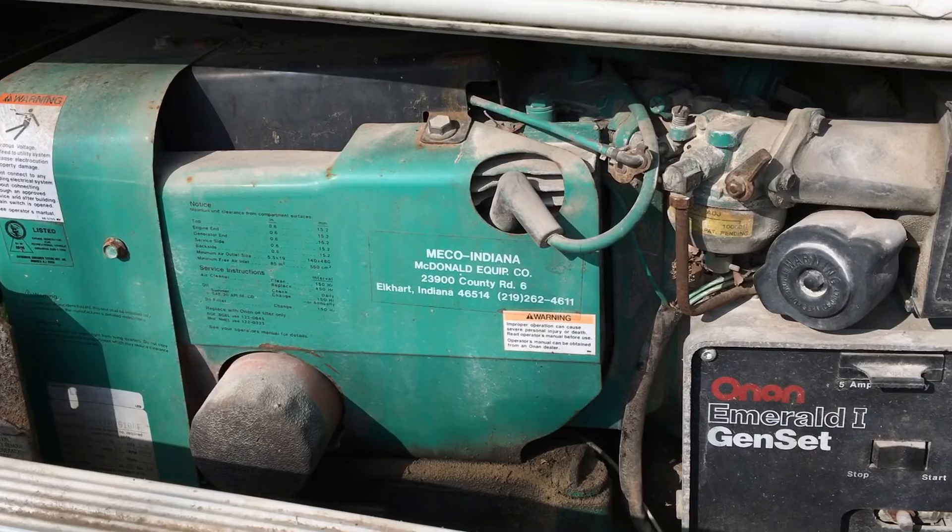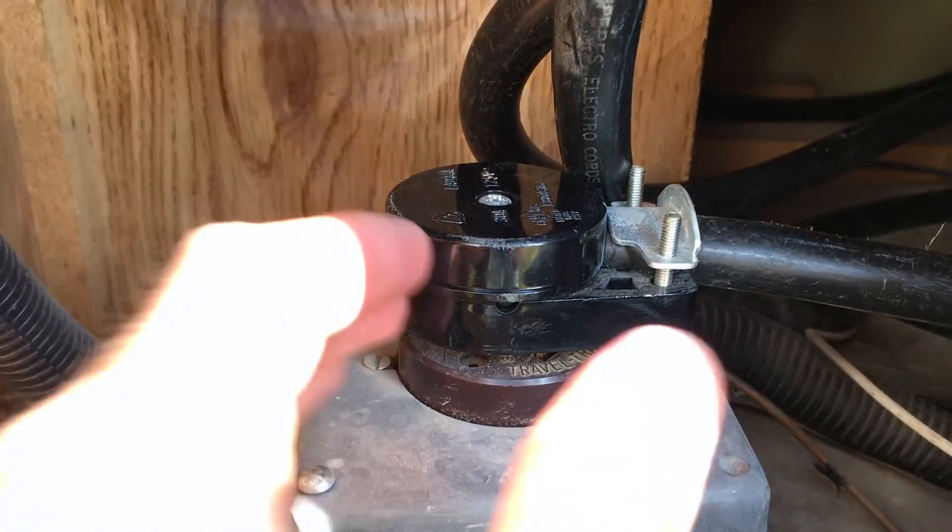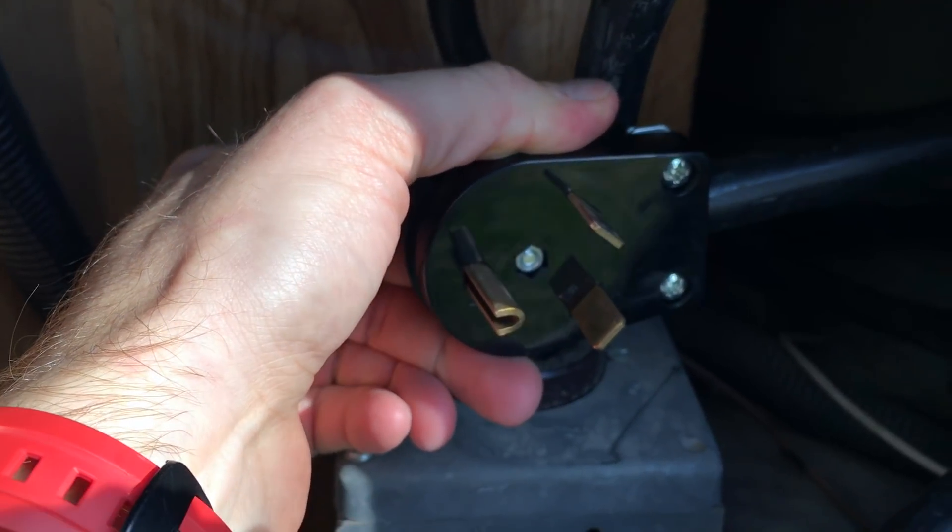When it comes to the AC system in your RV, there are typically three ways you can deliver power to standard three-prong plugs like you'd find in a normal house. You can either have an AC generator, you can plug your RV into shore power like at an RV park or a friend or family member's home, or you can have an inverter which transforms the 12 volt DC power from your batteries into 120 volt AC power to run your standard AC appliances.